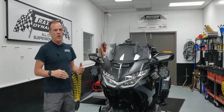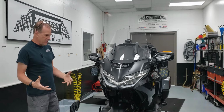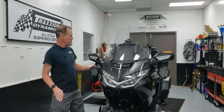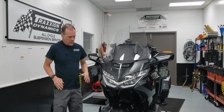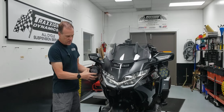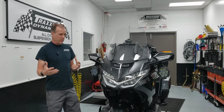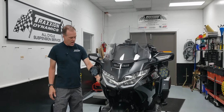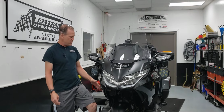It had no effect on or off, so the pack rack was not a problem. Other things we had added that could have affected the aerodynamics: there is an auxiliary tank back there, so there are some flat areas behind the driver. Obviously, these big clear water lights down by the wheel and up here under the mirrors are aerodynamic things creating turbulence. The Kuryakin wind deflectors on the side, which, by the way, work really great to deflect heat from the driver's knee.